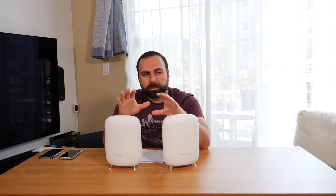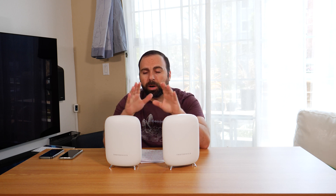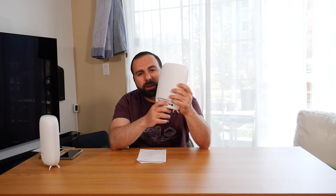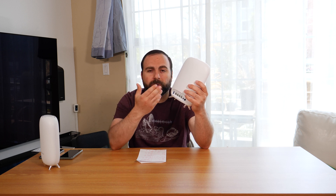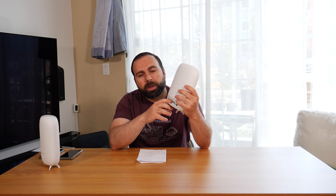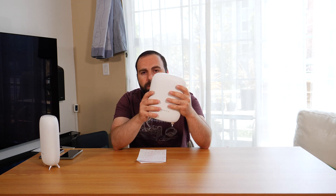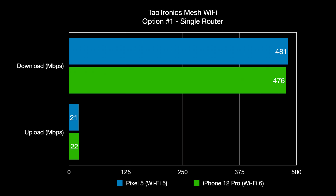Jumping straight in — I'm going to do this mesh Wi-Fi how I do all my others, keeping the same numbering scheme. We start with option one, which is when you get a router by itself and connect it to your modem using the WAN port, which stands for Wide Area Network. You have three other ports you can use to connect other devices. If you need more ports, you hook up any one of those three LAN ports to an unmanaged switch to extend your ports. When you hook it up to the modem directly and do a speed test, I get full speeds on both devices, which is what I'd expect.